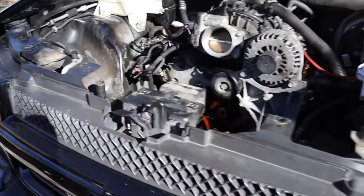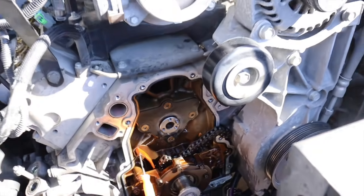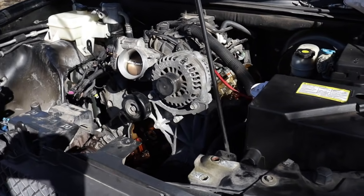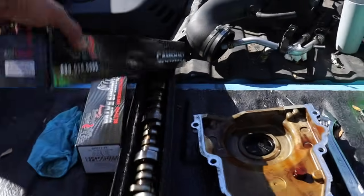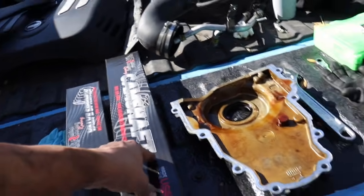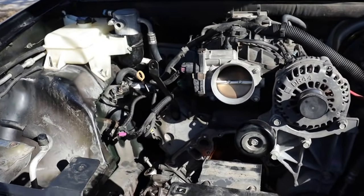Alright guys, so I have to stop. I just got the cam in, and the cam that I ordered is a three-bolt cam. All the cams I order are three bolts because most of the trucks are three bolts already. But on the Gen 4 LS motors, most of them come with a one-bolt cam — and as you can tell, this one did. You see here — one bolt. Usually what I do is I just buy the cam sprocket that's three-bolt and then buy the three bolts, and then you can just convert it to a three-bolt cam.